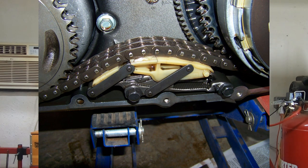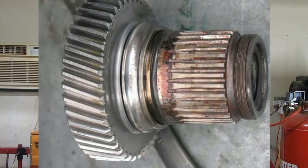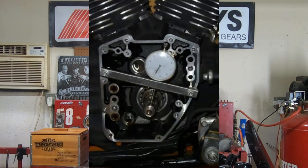With that chain, you're basically pulling your compensator, your transmission, your clutch — you're pulling all this together. You're pulling on those two shafts — your transmission shaft and your crankshaft — pulling them together. What's going to happen? Something's got to give. What gives? The bearings and the seals in the transmission. Not to mention, you're also creating more slop in that crankshaft within the engine. So when you go to check run out on that thing — nine thousandths, which is absolutely ridiculous. And when you get up that high, chances are you're probably going to start feeling some odd vibration within the engine.